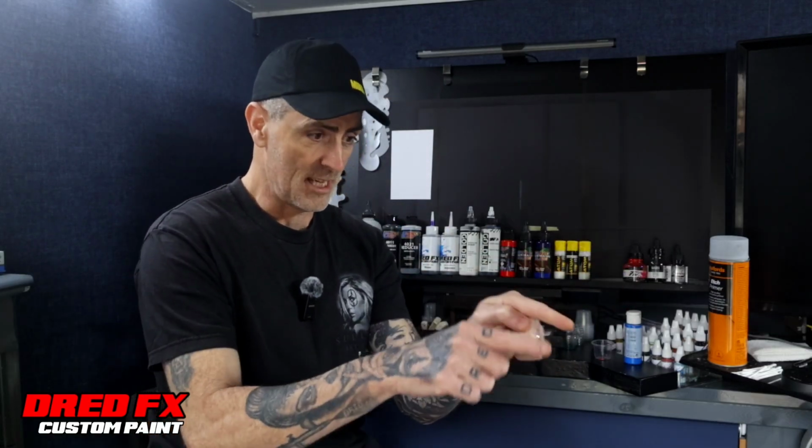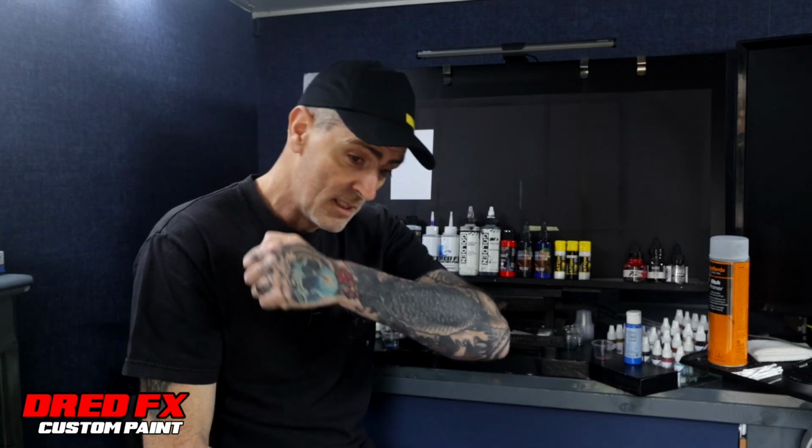Or put a piece of brown paper that you'd mask a car off with, stick that on the wall and spray your fan pattern against it and you'll see what your paint's doing. It's just always a good thing to check to see how the paint's coming out. Because if you were to start painting a car with your base coat, if you've got a real thick base coat and you go straight in on the panel, it will go down grainy, and it looks like sand. When it lays down, it lays like sand.